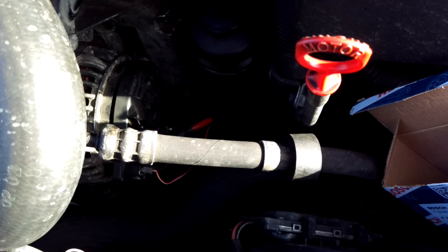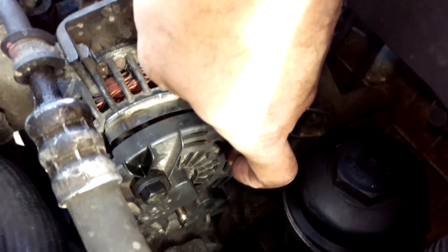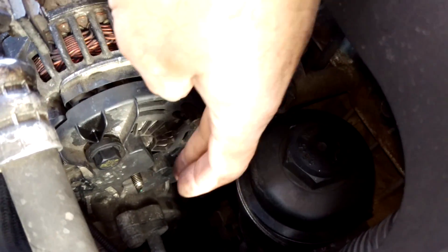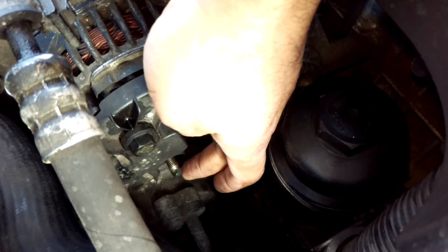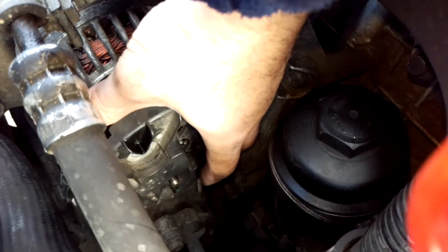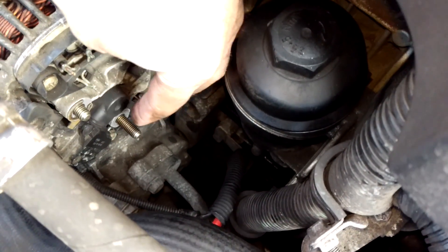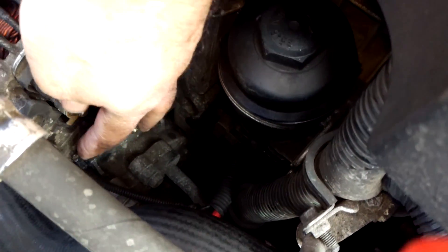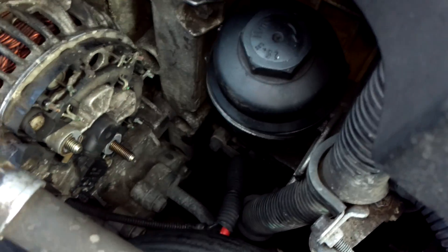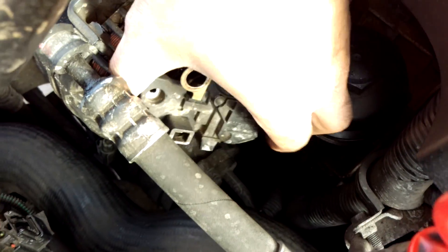I've loosened this here which I'll be removing. There was a Phillips screw just there, and there's another nut under the post here, so I'll take those off and that'll take the cover off. The cover can come off now, and then that's the voltage regulator just there. You just look at the new part to work out the screw locations. It was only three screws and the regulator just lifts out.